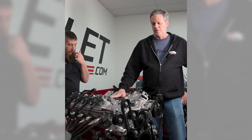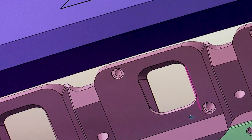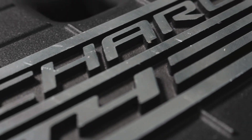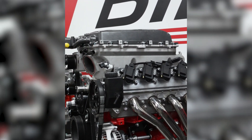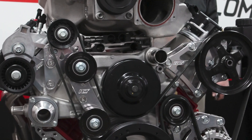The ports don't line up with the LS — that's the reason you can't just use the LT4 supercharger on an LS. They're both rectangle ports, but they're just not in line with each other. So what we had to do was blend the two together using a 3D blend tool path to transition from one port to the other. We actually got one of those Cadillac superchargers and put it on there just to see if it was going to work, and it actually matched up. After we'd already made the LT4 supercharger brackets, it was just a matter of seeing if the seam was compatible — and we found out that it is.